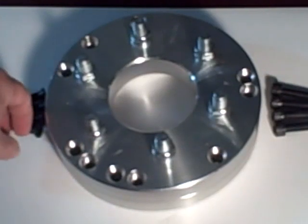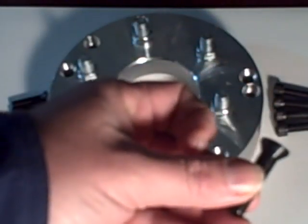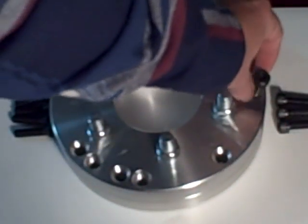I've taken out the bolts. You've got four bolts that have a conical seat — see the tapered seat on the head there — and you've got four bolts that are cap style bolts that have a flat seat on them. When you put it together, you're going to make sure you put the proper bolts in the proper holes.